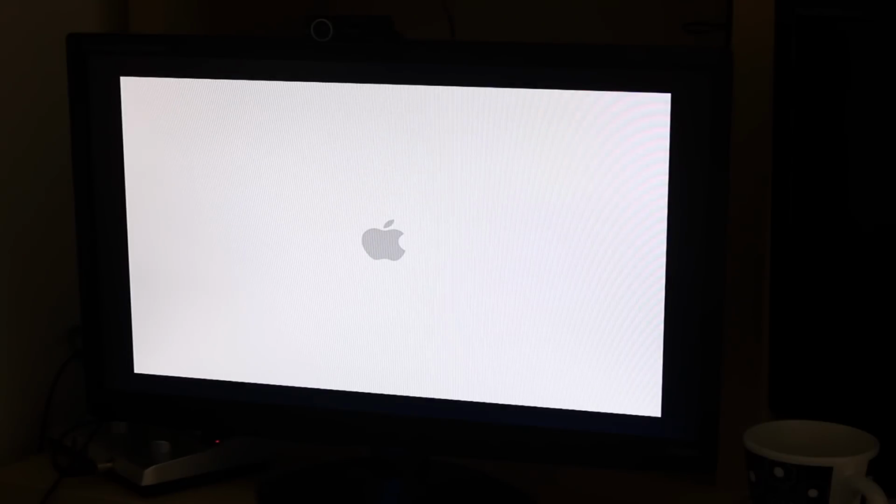And hopefully this time we'll reach the install screen. Now I've got the built-in HD 3000 graphics, and I've got to give my opinion on it. People are saying take your graphics card out and then install and put it back in, but I'll tell you now, that does absolutely jack all. All that does is it's for people who don't know what command to type to get it to work.